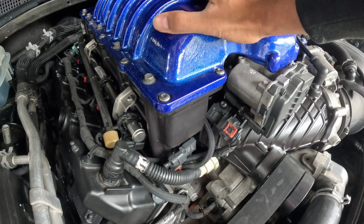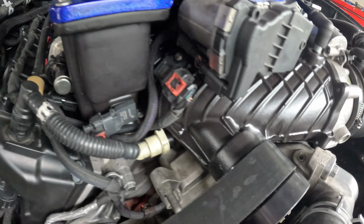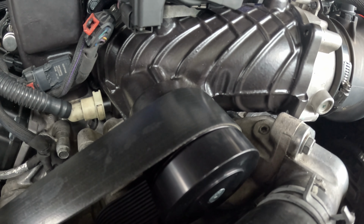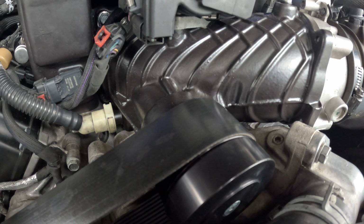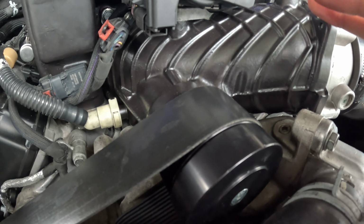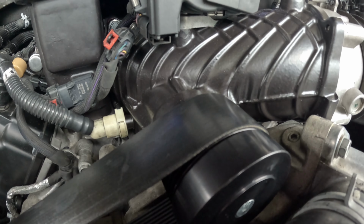But the supercharger has upgraded bearings and a billet bearing plate and all that. That was done by STG Motorsports, so I don't think anything got damaged in there. I think it was the snout, because I looked up this sound, and many videos sound exactly like this, the closest thing I've ever heard, and they all had bearing problems. Like I said, this snout is a stock snout with stock bearings in it. They must have just got overheated, because I'm not spinning this blower that fast. I just have a 285 pulley on it, which is not very far of an upgrade from a stock pulley.